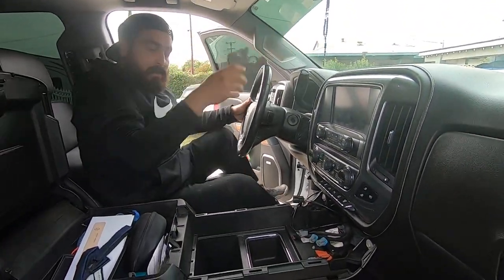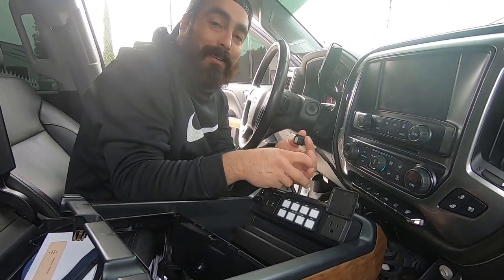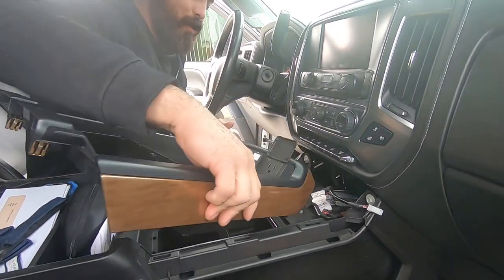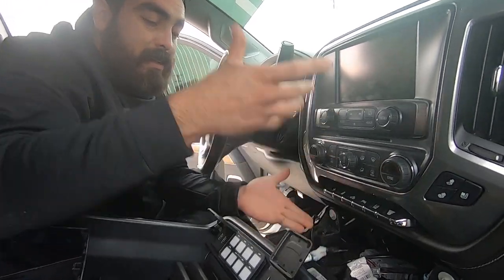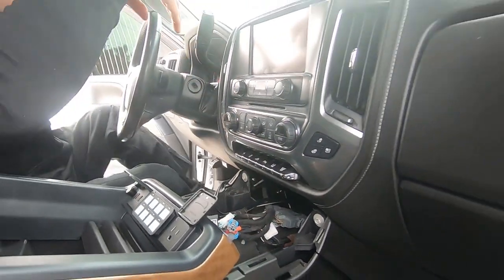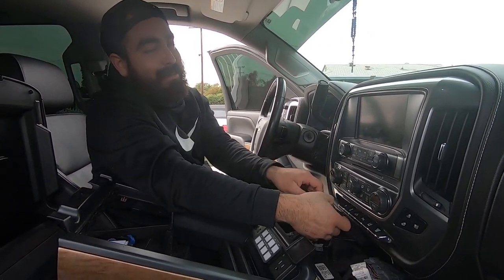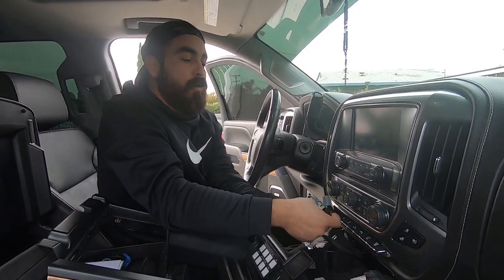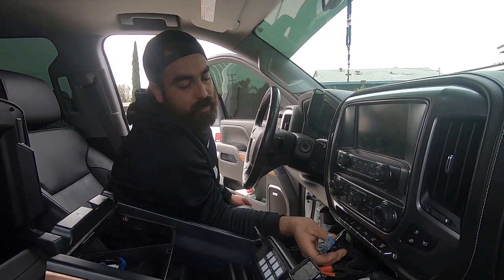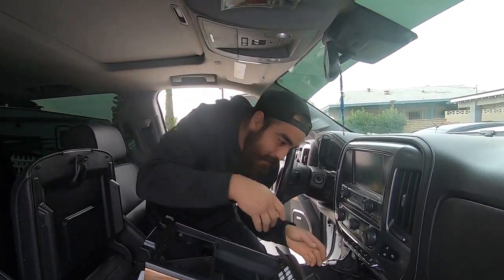This install part is gonna be pretty easy as far as the switch goes - we'll just plug our switch in. I did it backwards. Alright, just connect these - no big deal. Those are easy, we'll just plug everything back in and put it back where it goes. As for the 12-volt outlets on this Chevy Silverado 1500 to 3500 - this is a big daddy 3500 by the way - we're not using them. There's no fear of them shorting out; they're deep in the connectors and all this is plastic. If you feel more comfortable use electrical tape, if not just leave them.